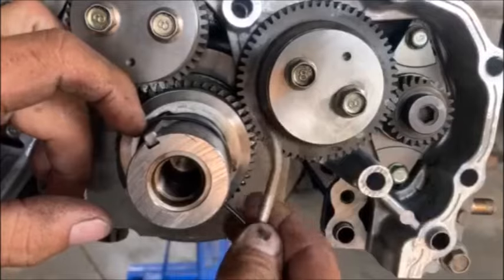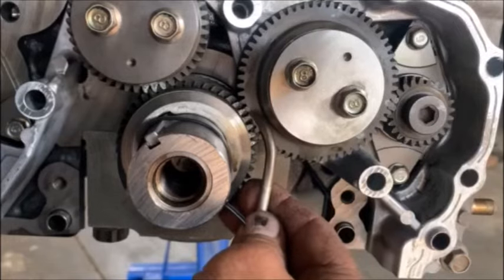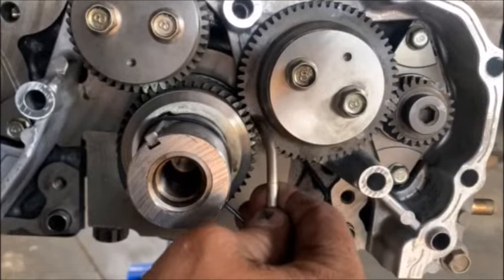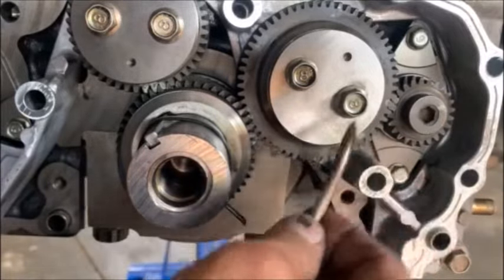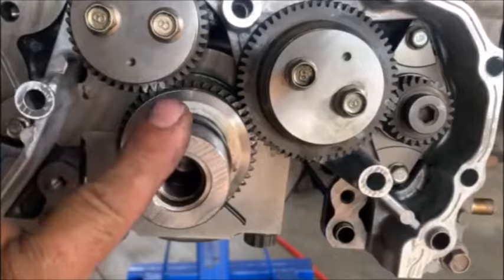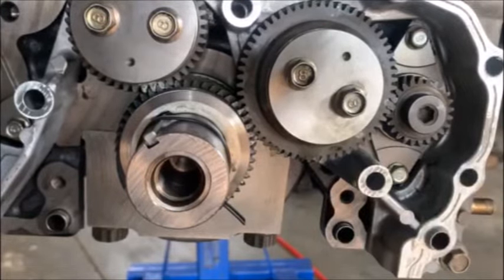Over there, that's the one I marked with a greeny-yellow on front; the one behind it is the one that's got the white and the dot on it — I marked it with my black koki on top — and it's between two teeth with the two dots on it, same over there. Here's a tooth with one dot marked white, two dots marked white, so it's always two on one. This timing here is done — that's the balancer shaft, this is just the idler gear, this is the crank pulley. It's not TDC or anything; don't worry about TDC, that comes later. This idler gear has got three markings on it. I'll move the camera to the side of the engine and we'll discuss that.